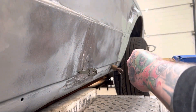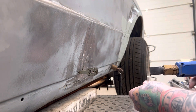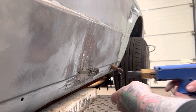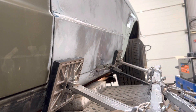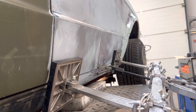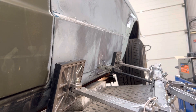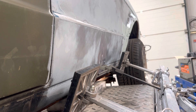The slide hammer ended up being useless so I decided to get the big puller out. Here I am welding the rings onto the side of the quarter panel, just to get it ready for the bar going through the puller. Nothing too exciting. Now grab the actual pulling machine, put the bar through, and as you can see it pulls pretty easy to be honest - it's a heavy duty machine. Pulled it out enough to get it to a place where I'm happy to fill it rather than just layering on loads and loads of filler.